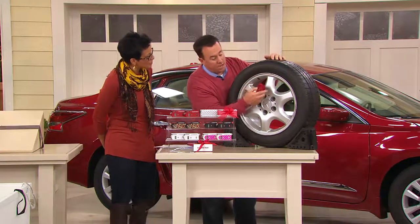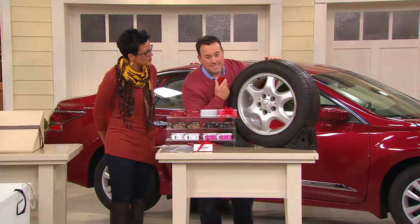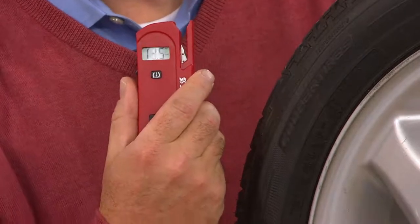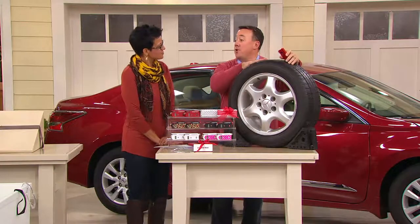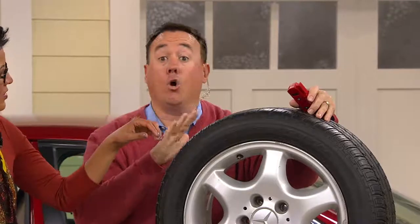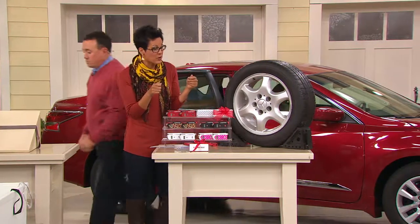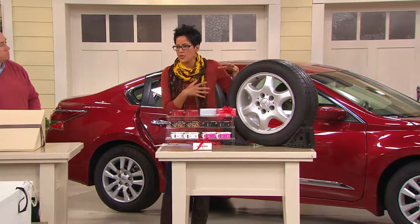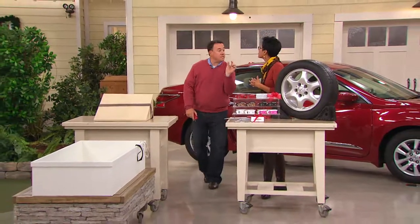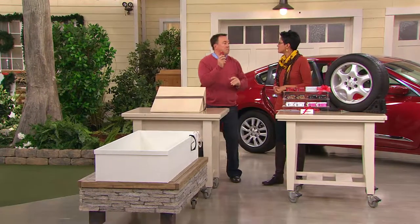And properly inflated. Here's how you check it — press this little button to turn on the tire pressure gauge. It is a digital talking tire gauge. 13.5 PSI. Not only does it show you digitally what your tire pressure is, it tells you. 13.5 PSI — I know for a fact this tire's supposed to be in the 30s. But if you sit here and punch it or kick it, it feels great, right? This is a wildly unsafe tire and you would have no idea. On every car in America, just inside the door, there's a sticker that tells you what your PSI should be. Your car will tell you what it should be, and this will tell you what you have.